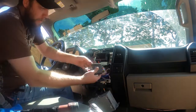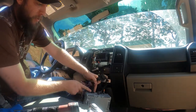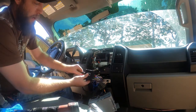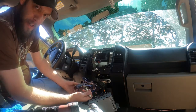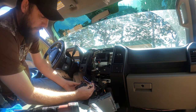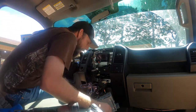Don't lose that one. So this thing right here is the actual unit I was waiting for, and it just goes into a T — in between the stereo and the harness — and this gives me the RCA outs that I needed for the amplifier. But my problem with this piece was, like I said, I didn't read the instructions. There's this little gain knob here that's supposed to be all the way down and I didn't do that. I kind of put it in the middle, so I need to put that all the way back down and leave it be.